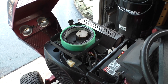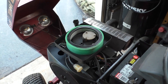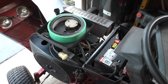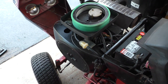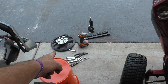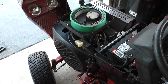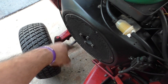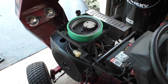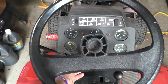Running pretty good. I have a new breather coming. What I did do is use RTV gasket maker on the inside of that breather and let it set up — put it on and now I'm not leaking any oil. When the new one arrives I can easily take the airbox off and swap it. I've also still got to put the debris screen on next. I think I've found the two leaks.